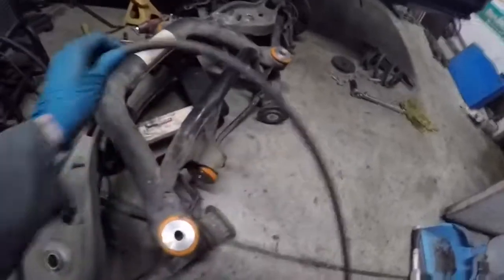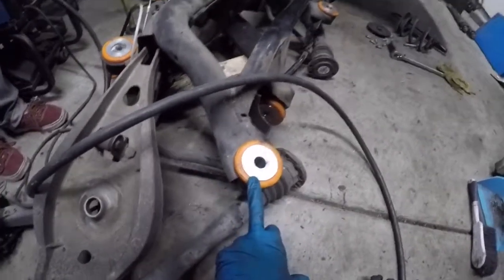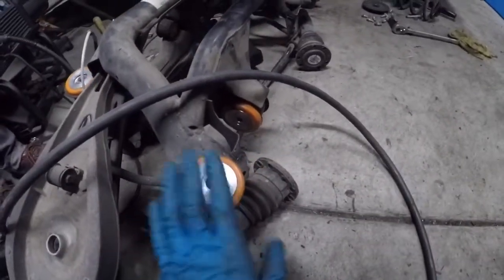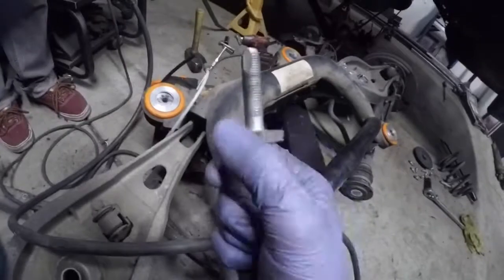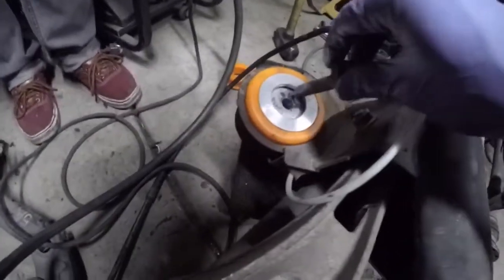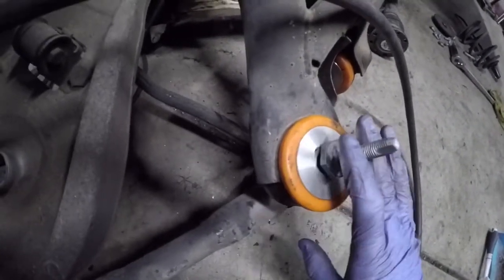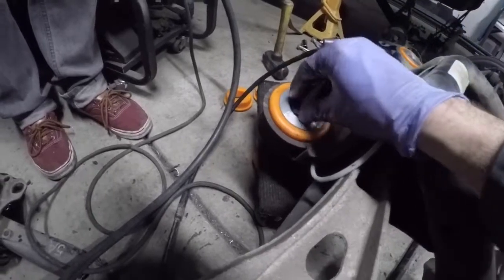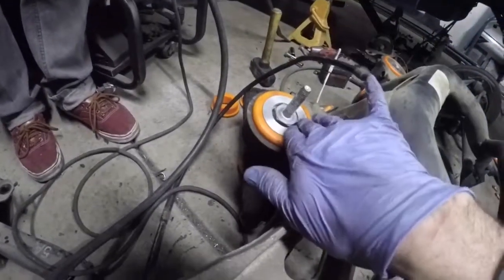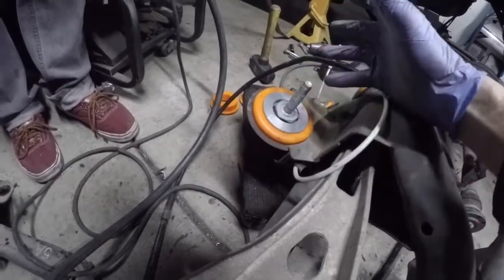This is the second part of the bushing removal for the E46 rear end. These are the bushings we pushed in. Normally we use Garagistics because they fit really well. This is another brand, and the problem we ran into is they were not shaved down in the middle, so this little collar wouldn't have sat flat once we plated it. We had to mill it out and cut the middle down because it originally sat raised. If you run into that problem, you can mill it down, drill out the inside, whatever you want to do — or just get the right ones to start with.